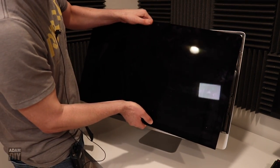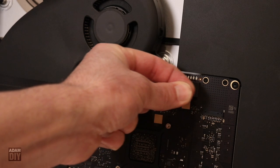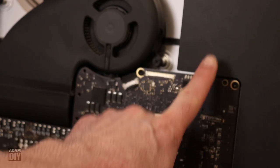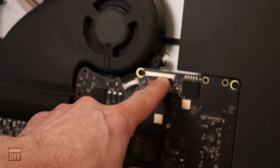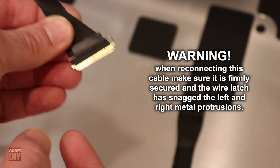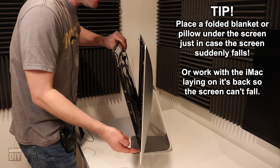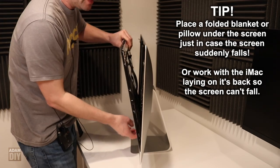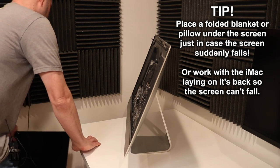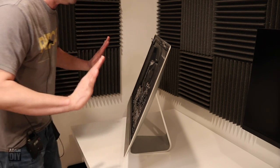There are two cables that this attaches to — I'll show you that close up. You're going to detach the cable from here; just wiggle and pull it, it has some little plastic tabs that depress on their own, so carefully wiggle it out and it'll come up that way. This one has a latch, so you have to release the latch to allow the cable to slip out. Grab this little plastic tab, lift the lever up, and allow you to pull this one out. Detach those cables while the monitor's in this position, leave it attached at the bottom, then fold it down carefully — it'll rip off that tape — and put it aside somewhere it won't get knocked or bumped and you won't drop a tool on it. Don't break it — you won't be happy.